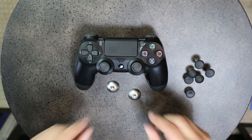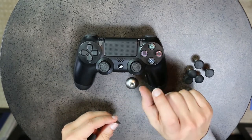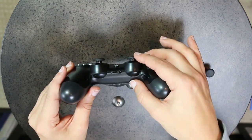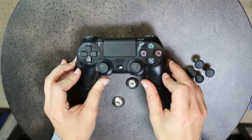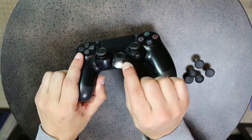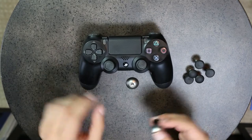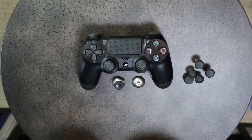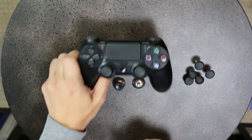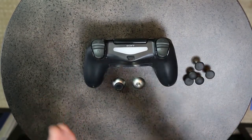It's magnetic and pretty good to go. One difference is that the standard PlayStation 4 controller stick is very shallow compared to the Xbox or Nintendo Pro controller. When you upgrade to this, you will have a slightly taller stick even with the smallest option. There are a total of five Phillips screws to remove. This is the newer PlayStation controller; the original is more of a nightmare to open, but this kit can still be done on older controllers.